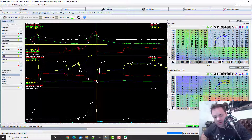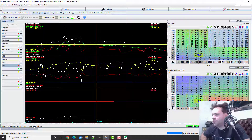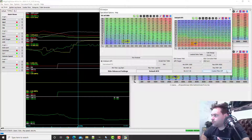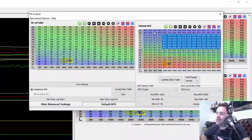The coolant temperature was around 113, working pretty good — around 109. I want to get over 100, so I'll set 90. There's my table. You need to have an AFR target table. This is my AFR table — this is what I'm chasing. In this low-load area I want to be around 14-15. Then up here 13s, 12s, 11s. At 200 kPa I want all 10s — high 10s, nothing in the low 10s. Let's run analysis.